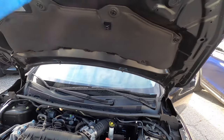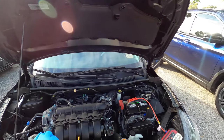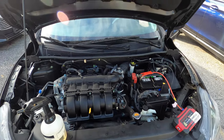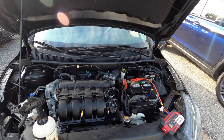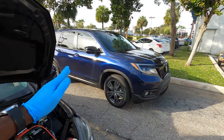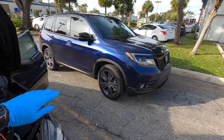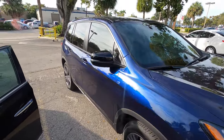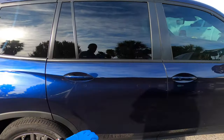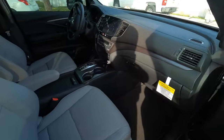So I know it's not getting any fuel. I'm gonna lift up the backseat and check for power and grounds there. If I don't get any power and grounds there, then I'll also check the fuse. By the way, this is my new 2021 Passport — there'll be a video coming on it because the other one got totaled, so I had to come out of pocket to buy this one. But just a little preview of what the inside looks like.